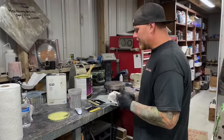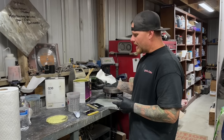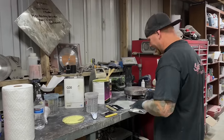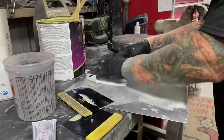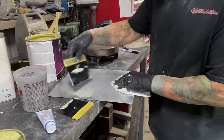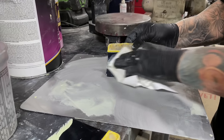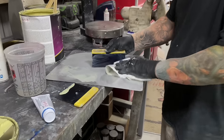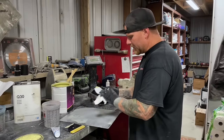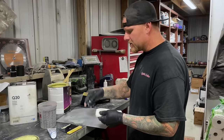When you guys are cleaning up, some guys will soak boards in acetone or lacquer. I like to just use acetone - put a little bit in a cup. Don't use a glove that's ripped; this stuff will go into your bloodstream. You can clean everything up with acetone. You don't want anything at all on these spreaders, so make sure you get this stuff completely clean. These are metal spreaders; you can use plastic ones - they both have their advantages. I like metal for tight even spreads and plastic for more curved areas. Keep everything clean, come right back and do it, don't wait. Have it ready for the next spread so you can keep being efficient.